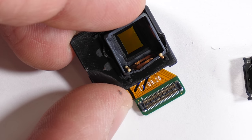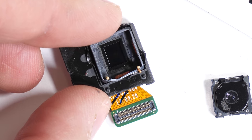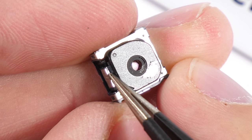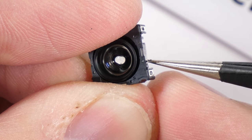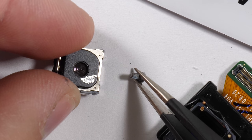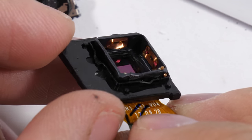I'll pop out the lenses from the housing to reveal the camera sensor underneath. This multicolored 12 megapixel rectangle is what receives the light through the lens and turns it into an image for your phone. One last look at the switch on the side of the lenses for the aperture movement. That switch, including the optical stabilization, are most likely accomplished through magnets — each side of the lens has a little magnet attached that attracts this screw, and each magnet lines up with the copper coils inside of the housing.